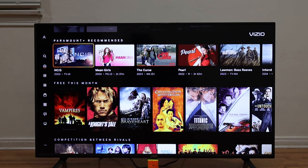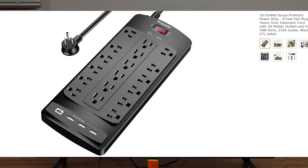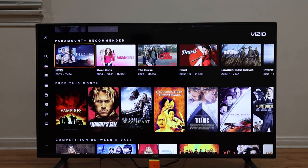Basically after these steps, you should have your TV back up and running. However, if the TV is still having issues, try this: if you have your TV connected directly into a power strip or surge protector, you should disconnect the TV from these devices and instead connect the TV right into a working wall outlet. Make sure the outlet you're using is working — you can connect your phone's charger to see if the outlet is outputting electricity. Also, please check if the power cord is in good condition. Check if the power cord doesn't have any sign of physical damage and is not snapped, because if it does, there's a big chance the power cord is not passing electricity to the power circuit.